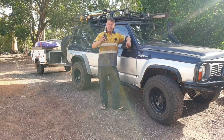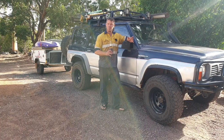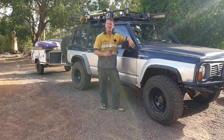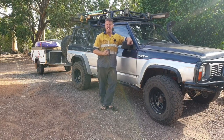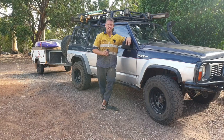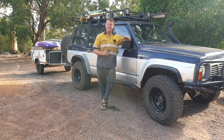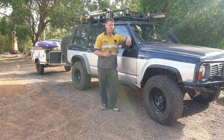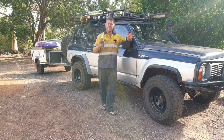We'll do that run again and see what temperatures we get. Today is currently 29 degrees, just so you know the ambient conditions. After the test run, I'm pretty surprised - I had temperatures between 87 and 88 degrees just cruising at 100 kilometres an hour, up to about 92 or 93 going back up a hill, but soon as you started coasting again it averaged about 89. I reckon it's a good mod - four bolts, cost me about $115 for that guard and it was free delivery.